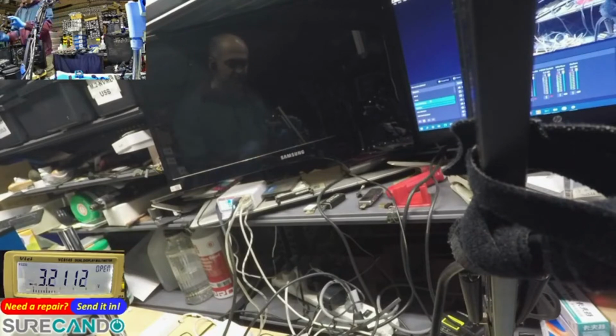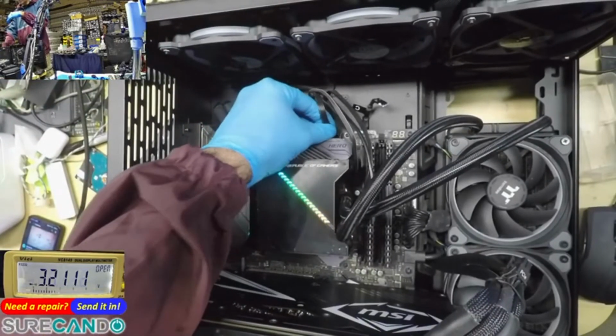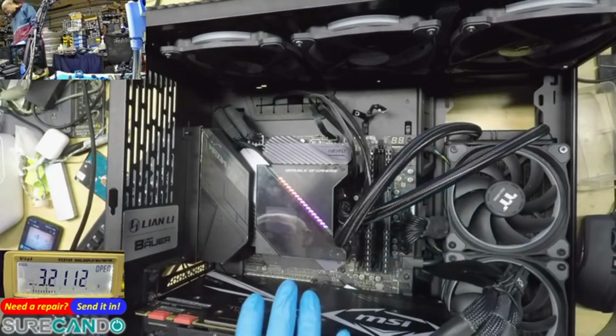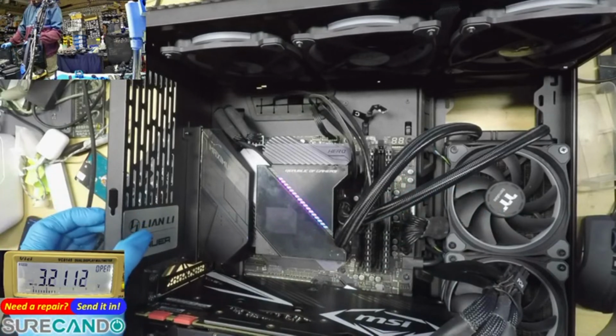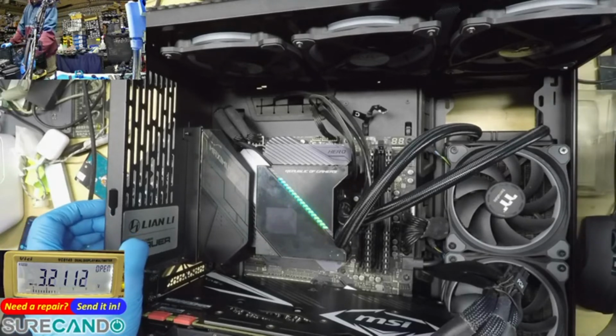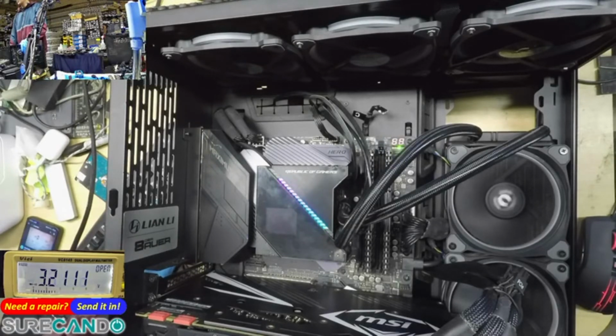So put this guy in the right location. There. Okay, the RAM is fine. Let's do something risky, like nobody uses CSM now. I shouldn't do this, but I'll do it now. Convert the file system from MBR to GPT, so you can boot from UEFI, which will make life easier with future upgrades, including the Windows 11 upgrade. I think it will be better with UEFI. Alright, so we're gonna do something crazy. Let's give it a go.